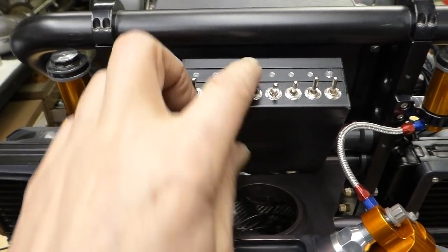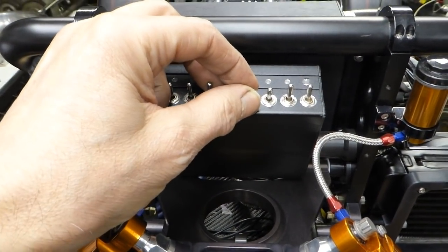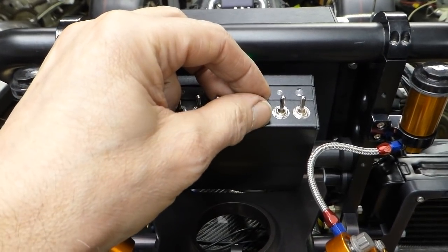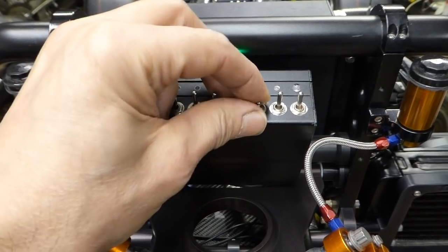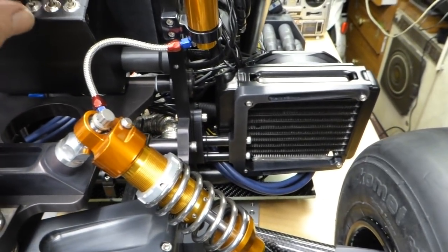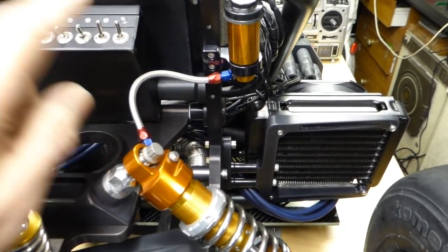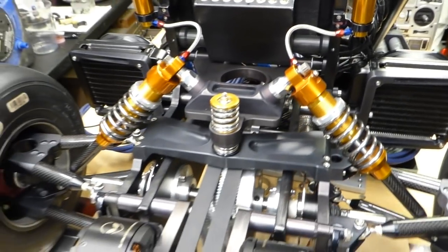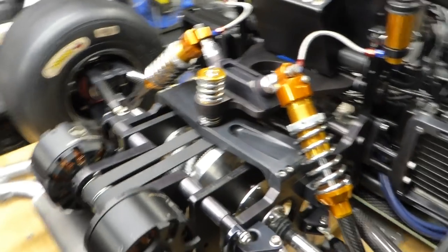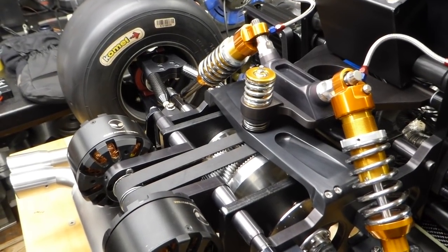Four is the injector, five is to switch the fan on, six is two-speed fans, seven doesn't do anything, eight is the ECU. This is hopefully going to be the anti-roll function, but whether it works or not I don't know till I try it.